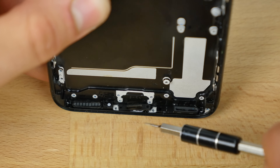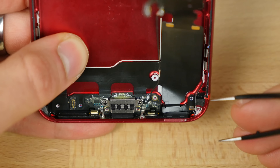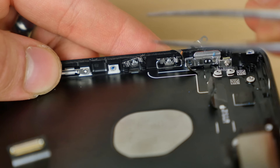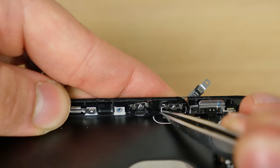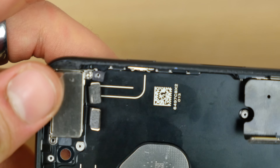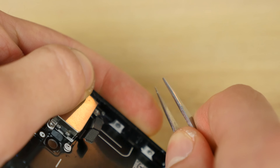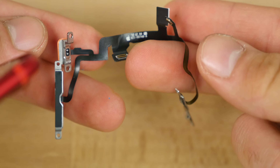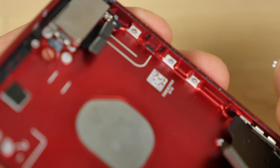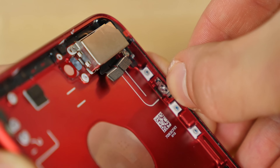It would help heating it up immensely. Don't forget the whole reason we're in here — pry out the lightning black connector so we can immediately reapply it into the red one. When doing the bottom speaker, make sure to take the whole speaker with you as the whole housing will come out. Now here's a tough one — the volume button. You basically have to pry this one over and out. To get the volume or power buttons out — I couldn't find a guide on this online, so I had to figure it out. Press the button to force it in, then push up on the right side of the clip, poke into the little hole and pull it out. One side goes up, the other out. You do have to replace the entire ribbon cable for the volume and power buttons as the color for the mute switch is what you want to switch as well. Then insert the black version of the button, plug the little pin in on one side, make sure it goes all the way in, and fold it down onto the other pin.